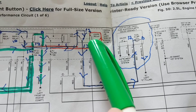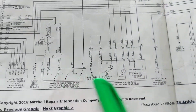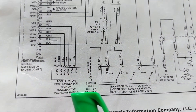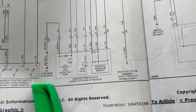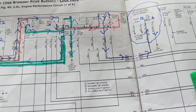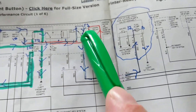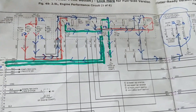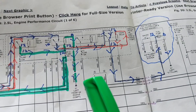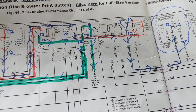When you diagnose a fuel pump problem, find that symbol in the schematic, then trace back where it comes from: the relays and the fuses. Don't worry about the other parts of the schematic — the accelerator position sensor, the transmission control switch, the canister — none of that matters for this problem. Find the fuel pump symbol and work your way back. If you suspect a fuse, go to the fuses in the schematic; if you suspect a relay, go to the relays. Thanks for watching.